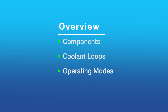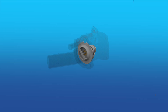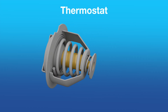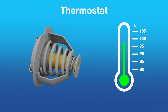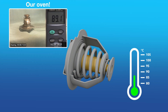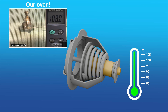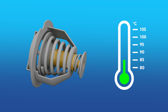So let's get a bit more into the weeds by listing all the different components, coolant loops and operating modes. Probably the most important component in the cooling system is the thermostat. The thermostat is a temperature controlled valve that sits at the engine's coolant input and governs which cooling loops are flowing at any particular temperature. In my very crude kitchen oven tests, when gradually heated the thermostat starts to operate at about 92 degrees C and is fully open by 108 degrees. When gradually cooled, the thermostat remains partially open all the way down to about 85 degrees.